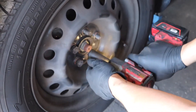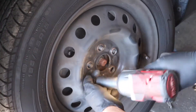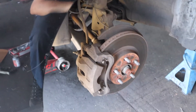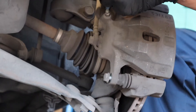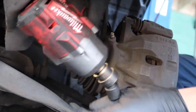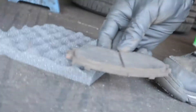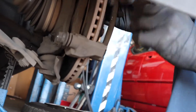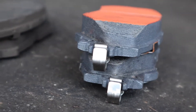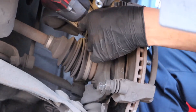Make sure you wear a mask, man — look at all this dust. You want to make sure you protect yourself. Move that to the side, get your 14s, remove those two bolts. This side — they were not as low but as you can see they were coming off the actual plate. Big difference, man. Take out the bracket — 17s.